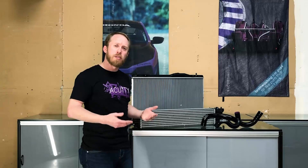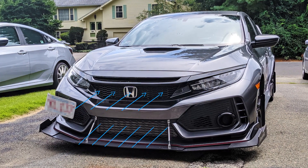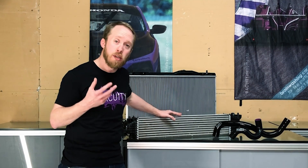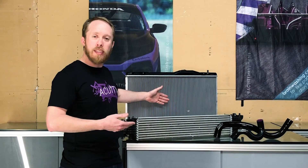It's important to realize that to cool the charge air, the refrigerant, and the engine water, you need cooling air from outside the car running through the heat exchangers. That cooling air has to be colder than the fluid it's trying to cool. So the air going into the intercooler has to be colder than the charge air, the air going into the condenser has to be colder than the refrigerant, and the air going into the radiator has to be colder than the cooling water. If you don't have this temperature difference, no heat transfer can occur.